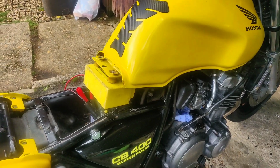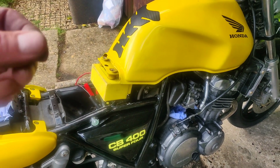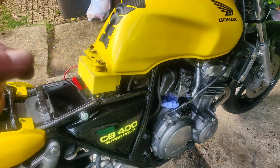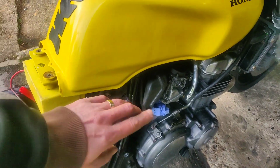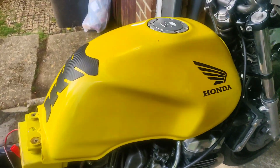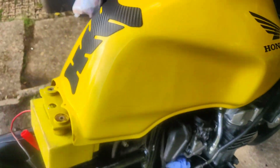And his bit was, he was saying, you've got the ECU back in there. Saying, well, I was poking in some line testers, and it seemed to spark back. So I've had a poke around those wires, and at some point, because you move it when you're taking the carb in and out, I think it's just snagged one of them, but it's back in and it's sparking on all four, which is absolutely brilliant, really good.